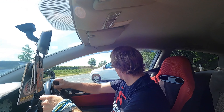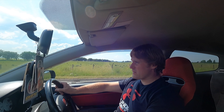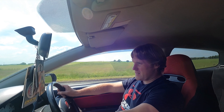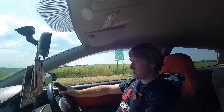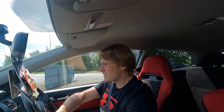It's really only traffic and stop-starts that are a problem, but if you rev it a little bit higher than you normally would it's fine. Going up the gears — no problems at all. You can feel the judder when you change down but not when you go up. The easiest thing is to give it a tiny blip of the throttle when changing down, or let it gradually match itself in. It's hard when you're braking at the same time though, because you can't put your foot on the throttle.